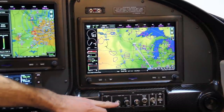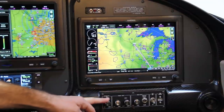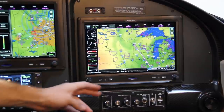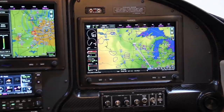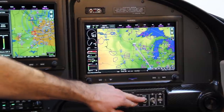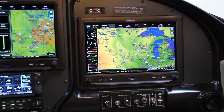Below that I've got controls for the heater and vent. I've got a knob that adjusts a NACA vent valve from AeroSport so I can control how much air comes into the overhead. I've got heat controls for the front so I can turn the heat up and down — there's a servo that runs the push-pull cable from the heat valve. I also have a splitter so I can choose for the passenger to get more heat or the pilot to get more heat. My wife is a freeze baby and I'm not, so that comes in handy. And I have a rear heat override control — this allows me to say I want the rear passengers to control the heat themselves with their knobs, or the front seat can control it from here.